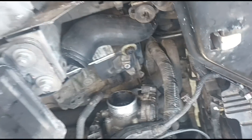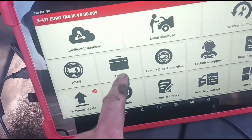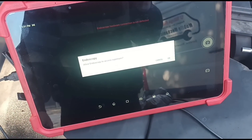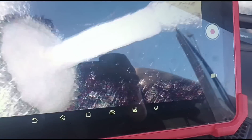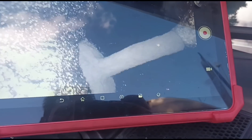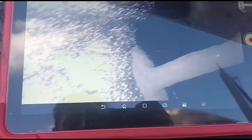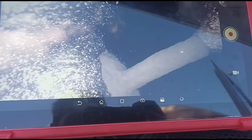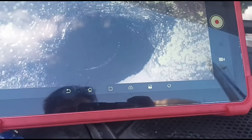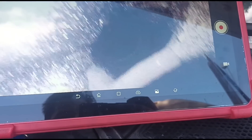I'm going to try and get the camera in there a little bit closer. I've got my Launch Eurotab 3 here and we'll go to toolbox video scope. I've got the camera in here trying to have a look at the valve. We can see there's some sort of dry hardened stuff, and then wet stuff around the edges, with dry hardened stuff on the shaft of the EGR valve. It's wet around the edges probably because I did use the Launch fluid cleaner on it about a week ago. It was in a terrible state in here before that — really bad.